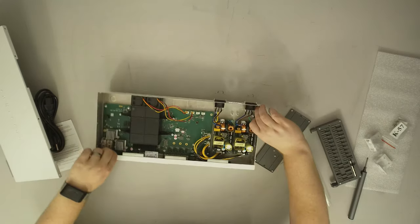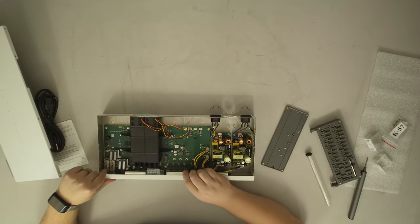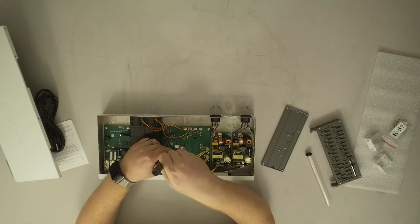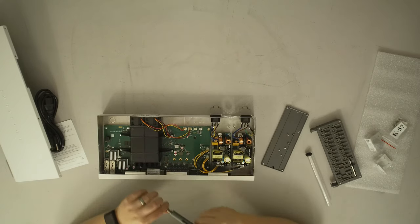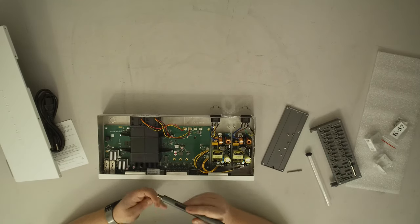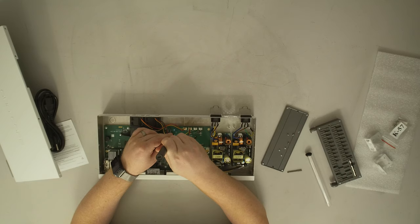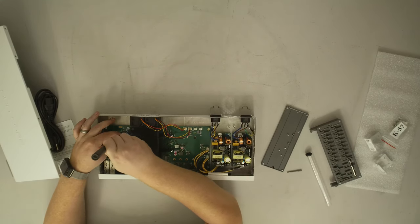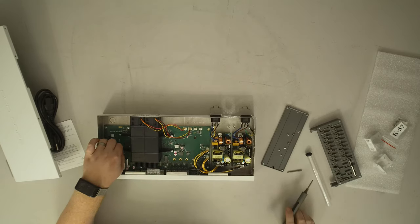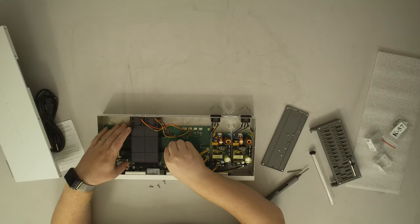Alrighty, let's take a look. So, not a ton that I'm seeing so far. Looks like we've got an M.2 slot for, I believe, an M.2 SATA. And I've got some screws that, are these a size smaller? I think those are a size smaller. Yep, so we've got some number one Phillips screws over a shroud, and I see some modules soldered to the board. Those look like RAM at a glance, so this may be limited to 8, or maybe 8 on board with a single SODIMM slot, so I'll know in a second.